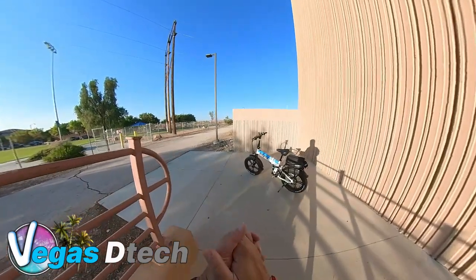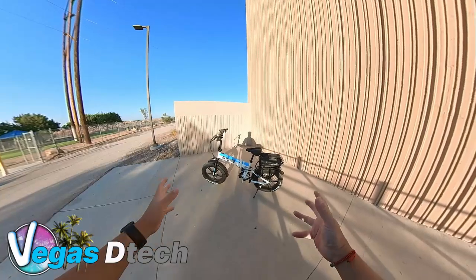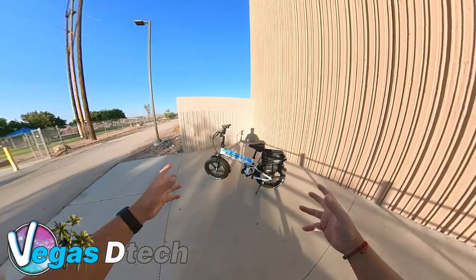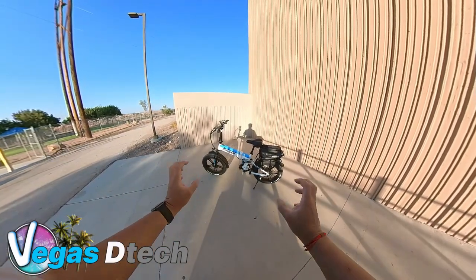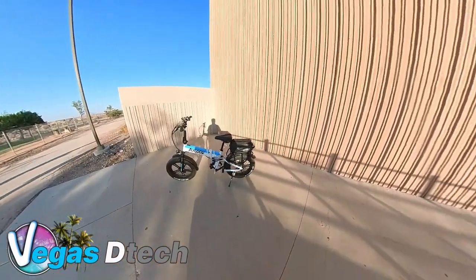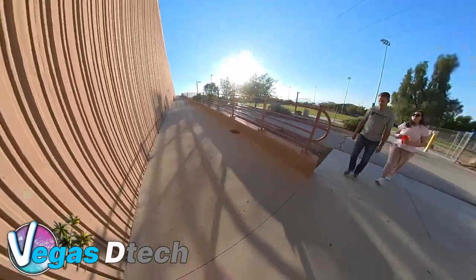So hey, I got nothing to say bad about the brakes on this right here. Like I said, a lot of people demand that a bike this big with this kind of power should come as an industry standard with 180 millimeter rotors and hydraulic brakes. This doesn't have that. It's the 160 with the manual brakes, and you've seen the skid mark right here. You got 25 to 30 feet of skid.